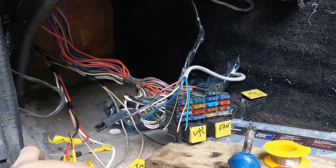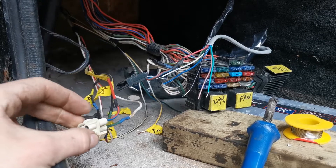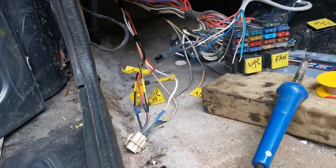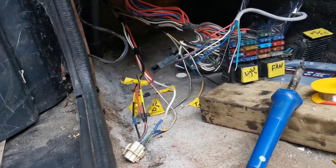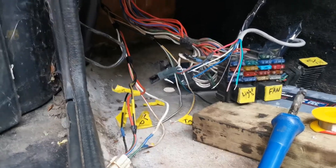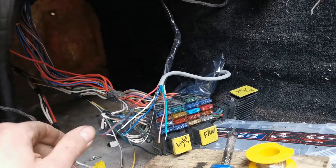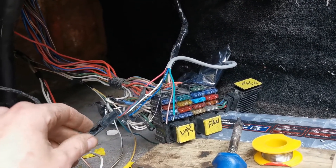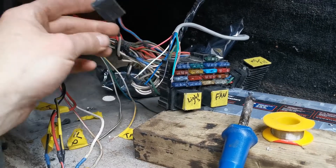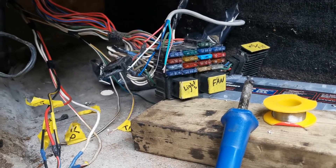What I've been doing is wiring in the ECU. I just went through all the different wires which quite handily I could use off the old engine wiring loom — I had a power, a ground, a crank and everything. So I just grabbed a spare plug and wired that into the new ECU harness, so that's all ready to go. Now I'm doing the wideband sensor which I may have forgotten about. I've got a spare loom, and these fuse boxes just slide out off the fuses, so I've just added an extra one on, put it onto the switched live and wired that in as well.